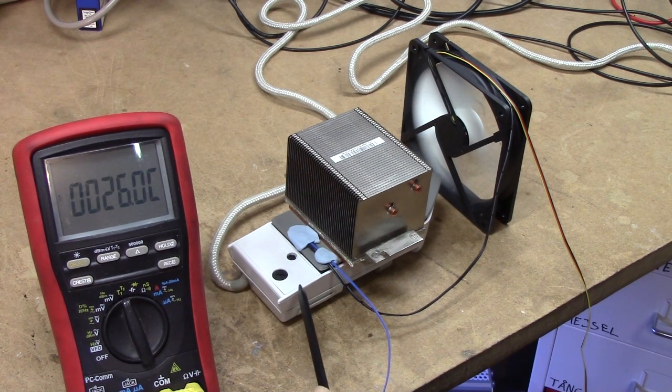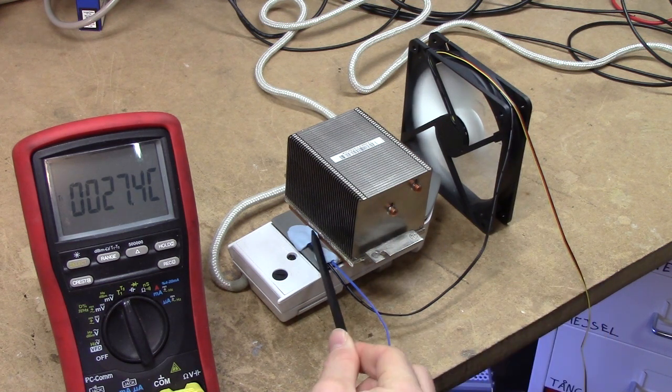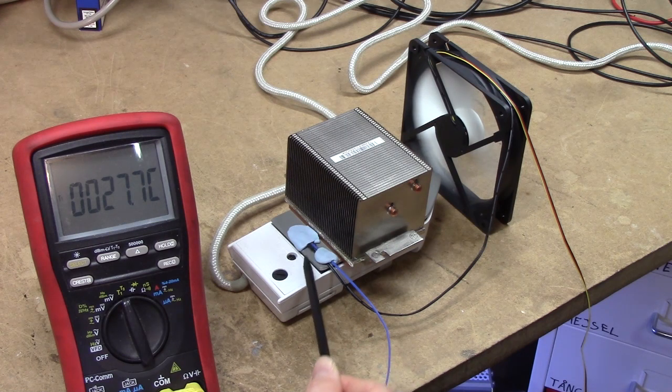This is a Philips Stewardess portable clothes iron, which I've just connected up through a power meter to my variable power supply. And I've put a little heatsink on it which the fan is blowing on, and I've attached the thermal sensor along with a thermal probe going to my BM869 there. Using the best thermal interface material on Earth: BluTac. And I've graphed the speed to temperature performance of this fan by just hooking it up to a regular computer and watching the BIOS tachometer.